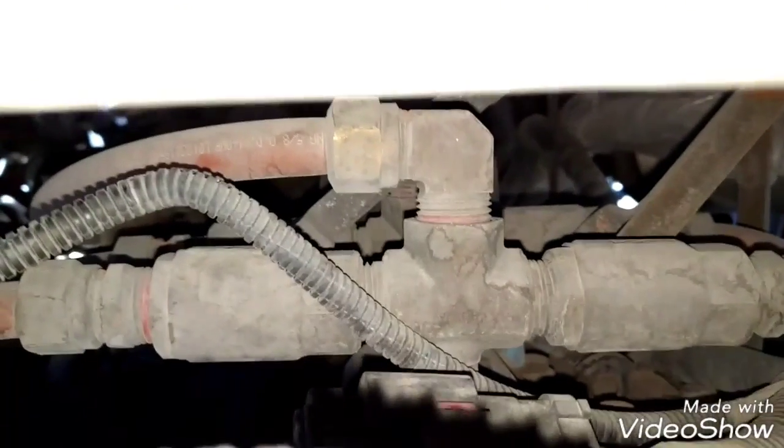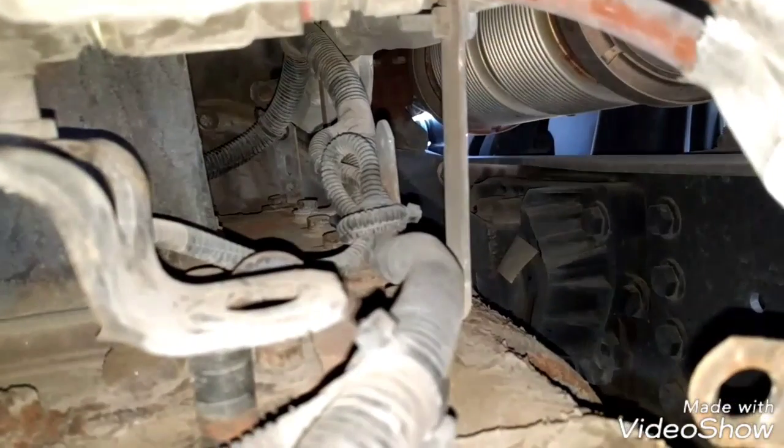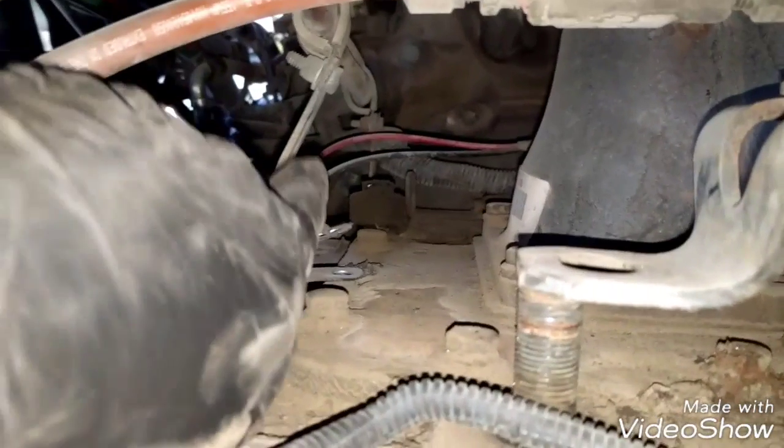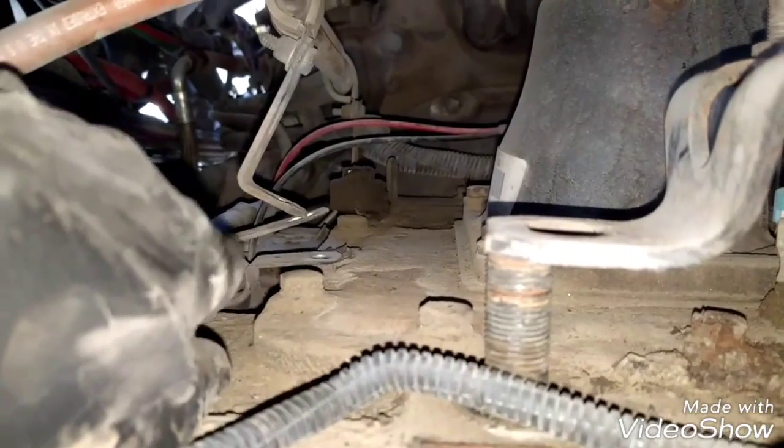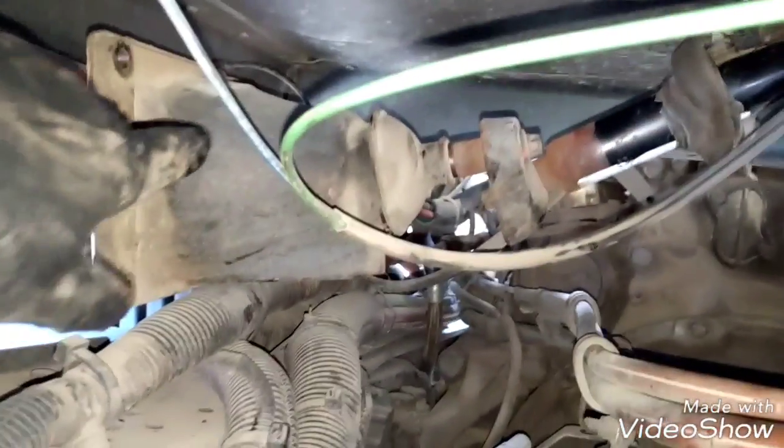And the fuel divider lines. The plate is off — there is more room to see the top of the transmission. Now we're going to disconnect all these brackets: there is another one in the front, there are two here, one here, and one behind. We're going to disconnect the reverse switch plug too, and those two hoses for the transmission — remember to reconnect them in the same position. After that we're going to remove the bolts holding the shifter. There are four bolts, two on this side and two on the other side. All the top components of the transmission are removed. The shifter is on the side — always try to put it on the side so it doesn't interfere with your work.